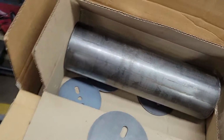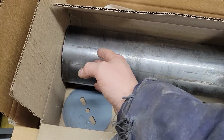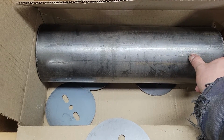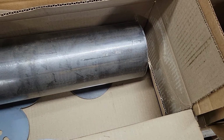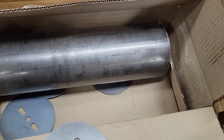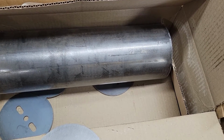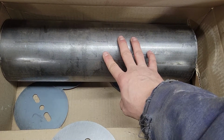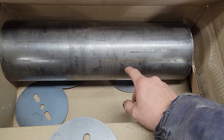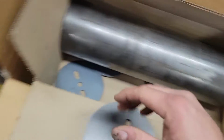So because of the design, because of the space, I'm going to end up doing 2 cups. There'll be one above the spring and one below the spring. I'm leaning towards putting kind of a shorter cup on top of the spring because that'll put the air spring itself kind of up inside the spring pocket. I've got a little bit more clearance there. I think it'll be a little better protected. Gives me just a little bit more unsprung weight in that I'll have one of these cups added to the trailing arm on the suspension, but I think that's probably the better way for us to go. It allows us a little bit better clearance here anyway.